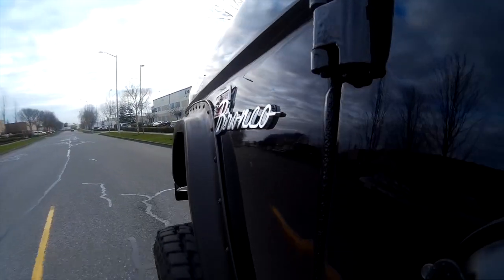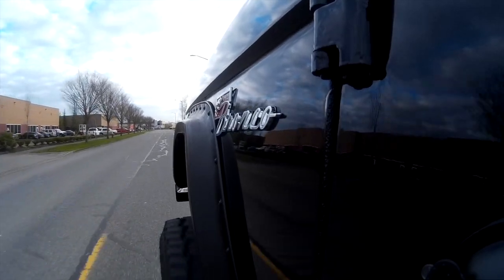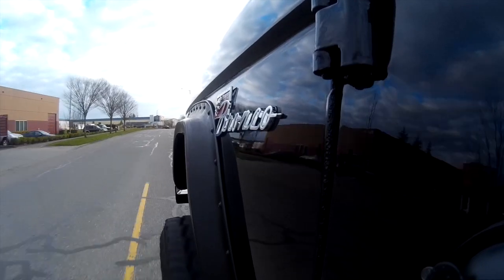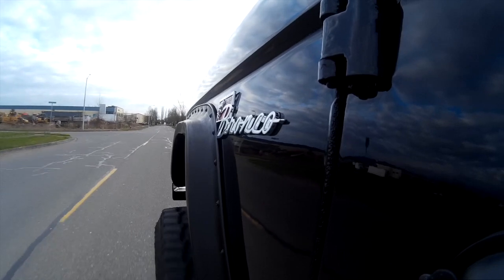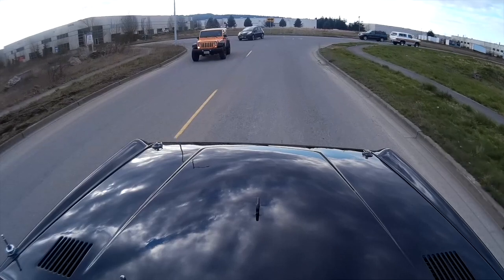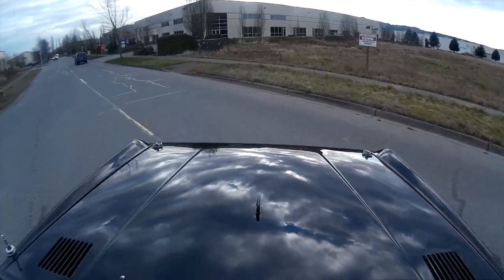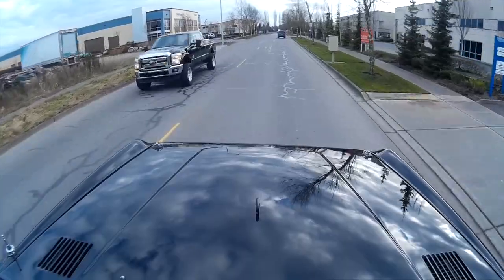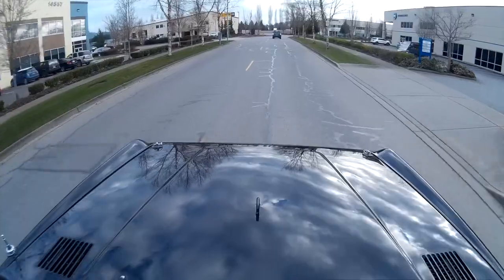You can one-hand this thing at 60 miles an hour. I personally put about 50 to 60 miles on it and I've been very impressed with how it drives. Out back, the standard leaf springs have been swapped for an 11-pack Deaver setup. This gives you tremendous articulation, but because they're a small spring they're soft — it doesn't bounce you down the road. It's a very soft ride, and off-road it will articulate like crazy. Best of all worlds: articulation, ride quality, and durability — it's a US-made spring, very high quality.